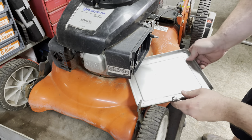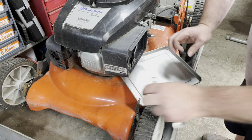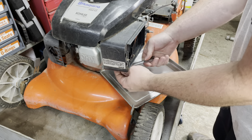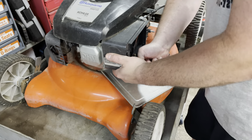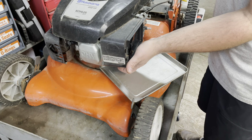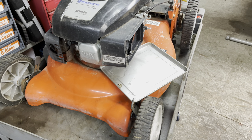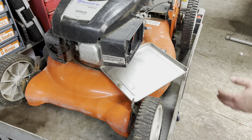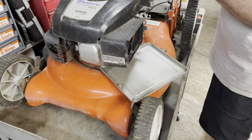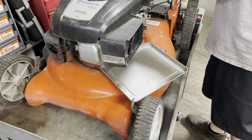I don't know how much we're actually going to be able to see, but I've gone through my shop and found my cleanest dirty tray. We should be able to see if there's water, which is mainly what I'm after. I'm using a 10 millimeter to get the bowl nut off. There's no shutoff, so I'm expecting more fuel to come out. It's plenty full.